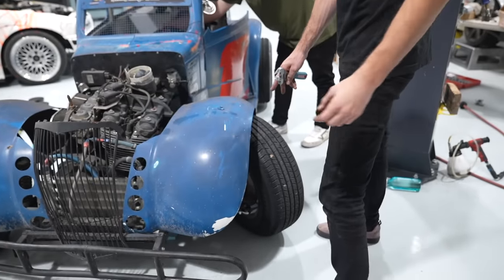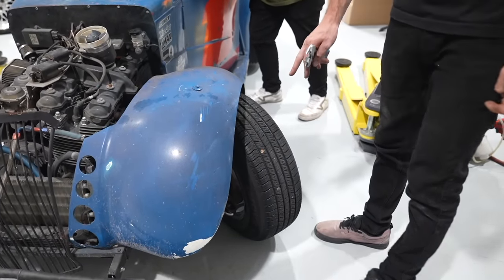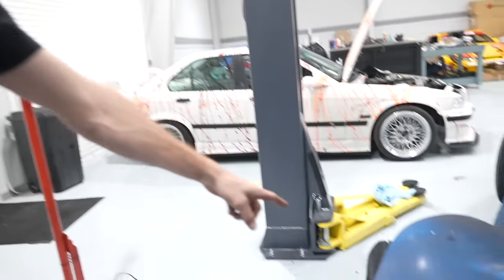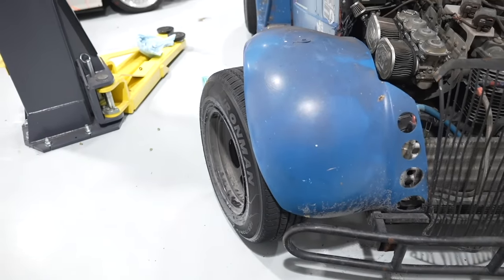Good choice. Coming soon. You can see on the leading wheel, this is about the maximum angle that we can have. The problem is because of where the pickup is, the trailing wheel isn't getting as much as it could. I'm kind of cheating it still with toe out a little bit because the rack is limited. I can't put a rack spacer on it. So right now I'm gonna drive it like this.